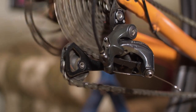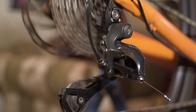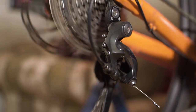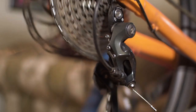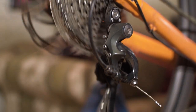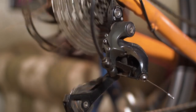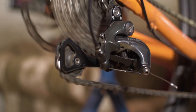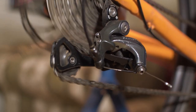All right, we're on small-small. I'm going up through the range and going back down. On the small chainring, my smallest gear is 32 front with 40 in the rear, and then 11 in the rear is the high end — which would be cross-chaining. I'm going to go up into the big chainring now.